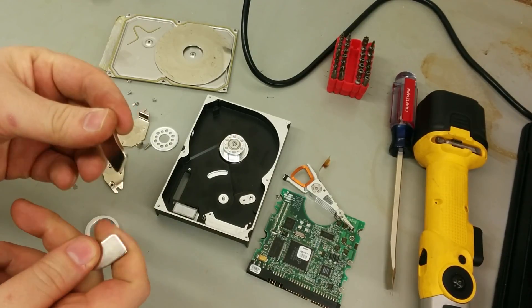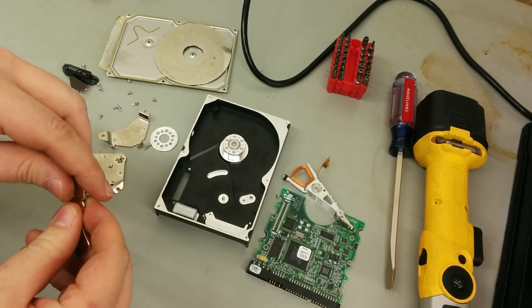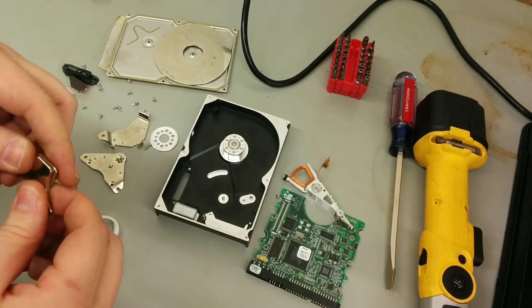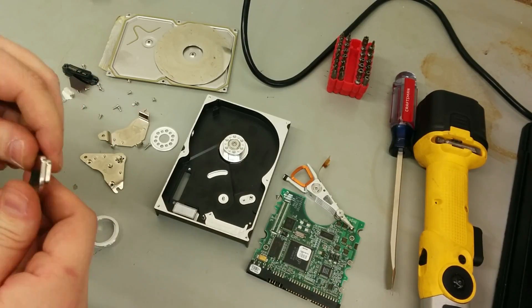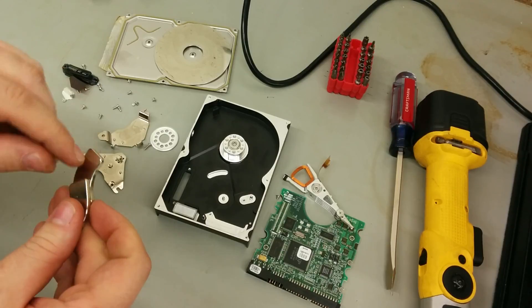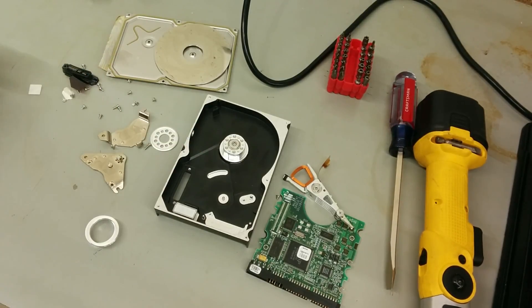These look metal but these are actually nickel plated. Neodymium iron boron magnets are actually a ceramic — they're very fragile. If you were just to let them go on their own they would shatter. So we have to be careful with them because if you do end up breaking them, besides the ceramic being a little bit sharp, the nickel plating also turns into a kind of razor's edge. So we want to keep them in one piece.